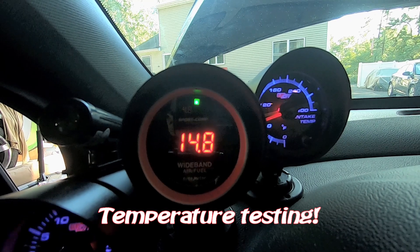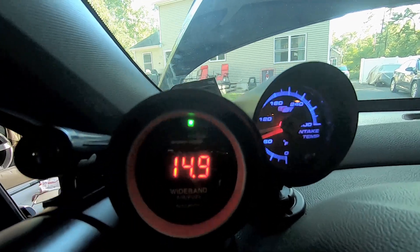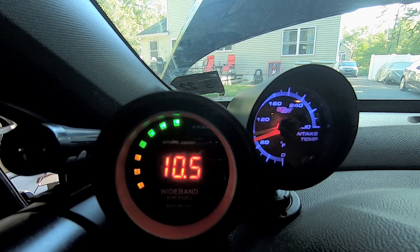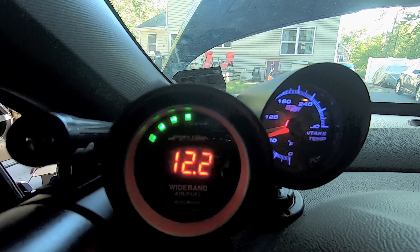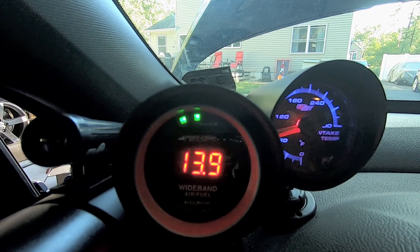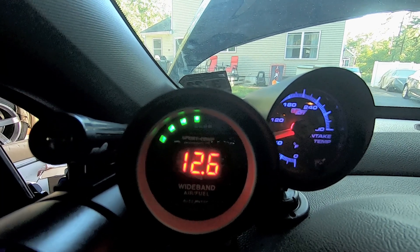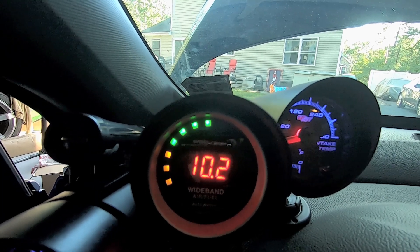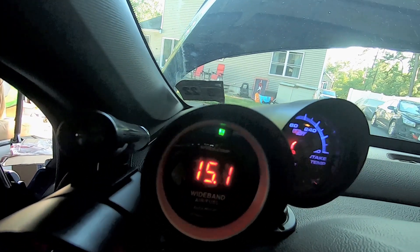What I'm doing right now is I decided to do a test in the garage. Before I take this car out for a spin and actually show you the driving impressions, I wanted to let the car get warm. So I let the car idle for a little bit. I let some heat get into the intercooler and the intake manifold so I could show both temperatures and show a difference. Then what I decided to do is keep the engine at a high RPM and fluctuate the methanol injection. I didn't want to keep holding the button, which would cool down intake temperatures much faster. I wanted to fluctuate it to give the engine a chance to actually use the fuel that I'm dumping down its throat. You could actually watch the needle move, and this is a good indication of what methanol injection can do for an engine.